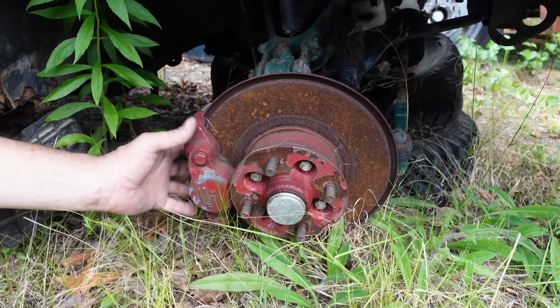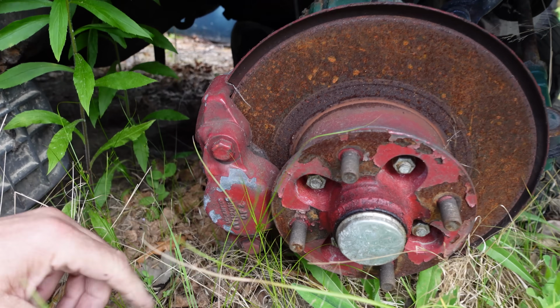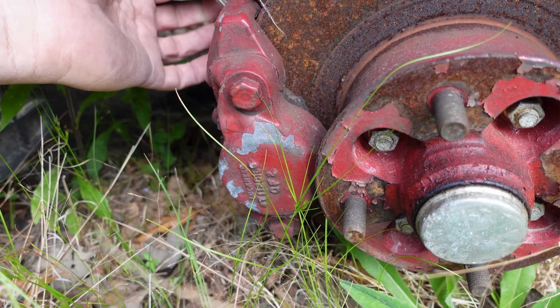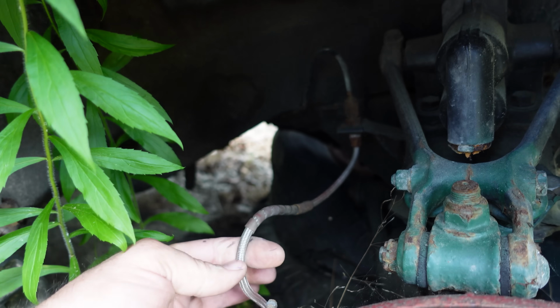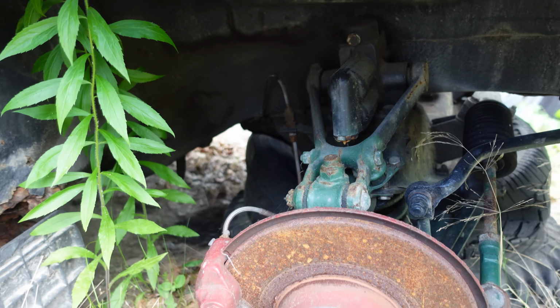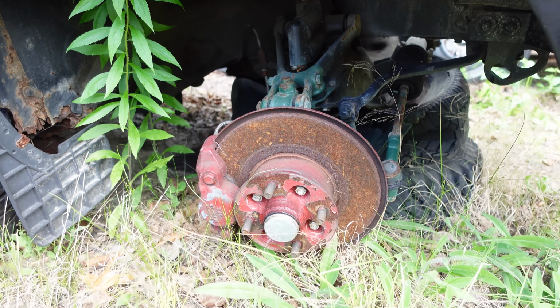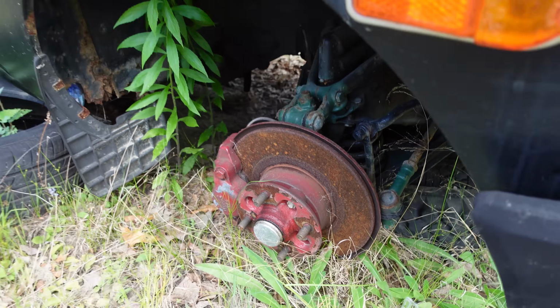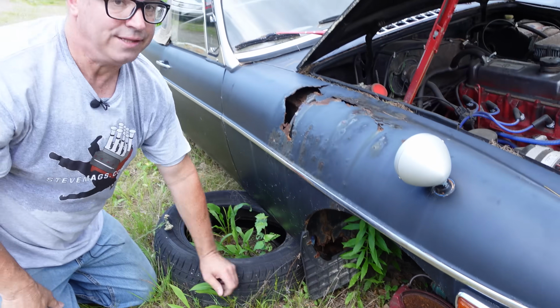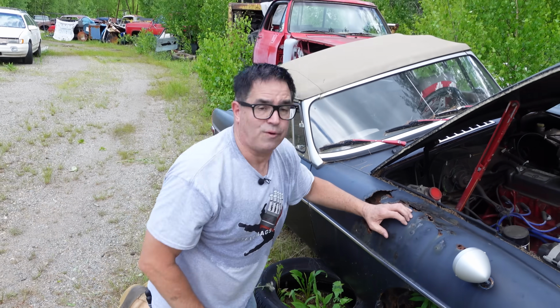Lockheed made these puppies. Here's the single, it's a twin piston caliper. This braided stuff right here is aftermarket. So whoever had this car probably wanted to have the assurance of braided hoses. And one thing about braided hose like that versus the factory rubber stuff, when the fluid gets hot, these are far better at preventing the fluid from expanding and causing sort of a bit of a drag thing that can happen on really hot disc brakes.